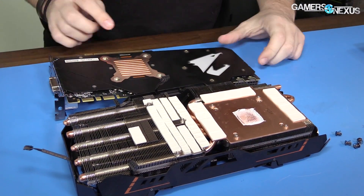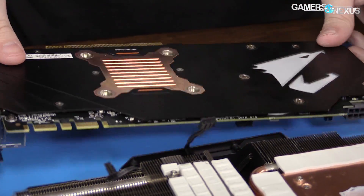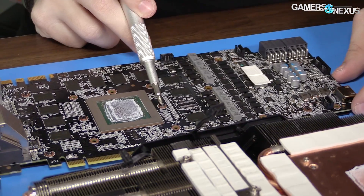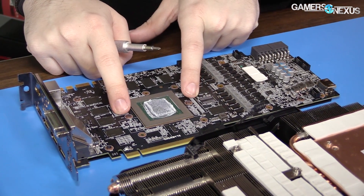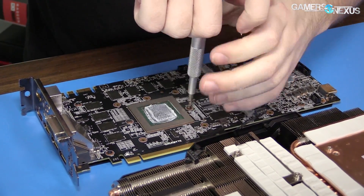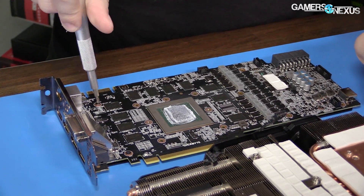The back plate has these Phillips head screws, and the other ones you don't do anything with. As soon as these are out, you can just pry the card off the base plate — that's not normally how easy it is. Once we get under there, you can see that these screws are where the rest of the back plate is being held on, so we'll have to remember to put these back in during reassembly. They're on the sides horizontally of the GPU, one bottom center between these two, one near the power. The screw size is the same as the rest of what was used in the back plate, so that makes organization easier.